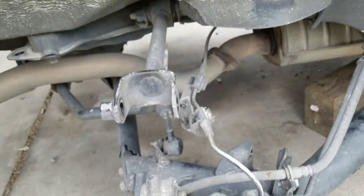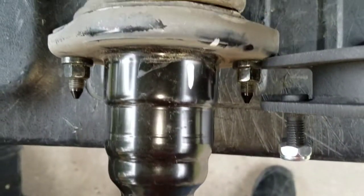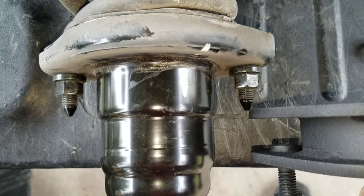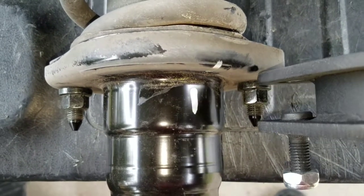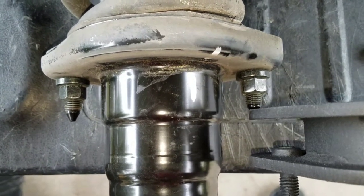I did come up with one problem — I bought a lift on eBay that states one inch. It's a little one-inch spacer that goes in the rear and a two-inch spacer in the front. I came across this first problem: the one-inch spacer, when you put it on, that bolt hits the next bolt. So I'm going to work on grinding this section of the bolt off just a little bit off the top to try to get it to slide in, or I'll put a washer there to space it off.